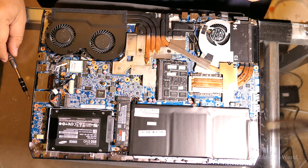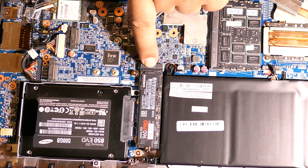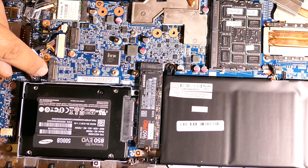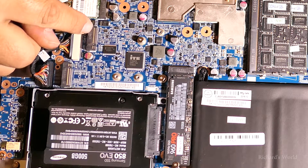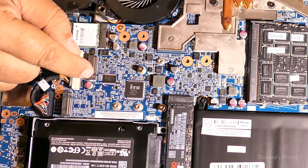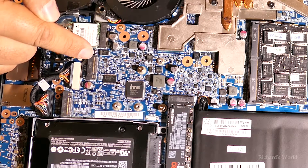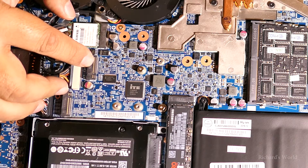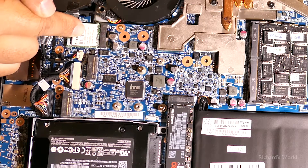The original SSD is here — this is the NVMe one right here, and this is the only slot that will do NVMe. Here's SSD slot number 2, which is only the SATA 3 interface. And here's actually another one, but this one is labeled as for the modem, for 3G. I'm curious to see what happens if I put a regular M.2 SSD in there, because if it works I could put two M.2 SSDs in there. And here's the slot for Wi-Fi and Bluetooth.